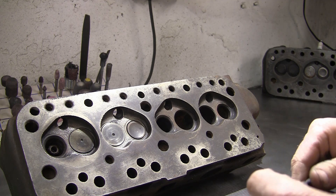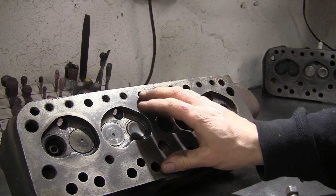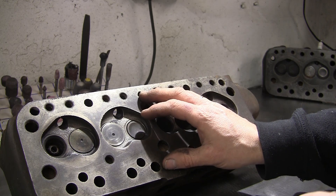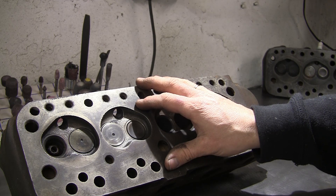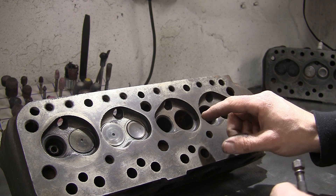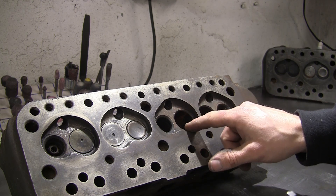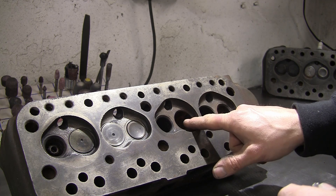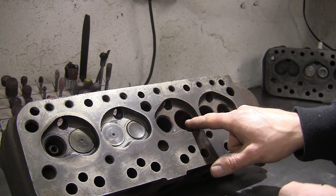For those of you that follow me on Facebook, you might have seen a few weeks ago I did some flow bench testing of a 295, a 202, and a 4810 casting. The 295 flowed the most, the 202 second most, and the 4810 the least — partly due to the valve size difference, as the 295 casting has a 30.93mm inlet valve.